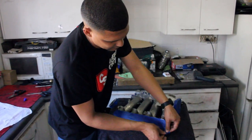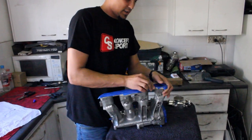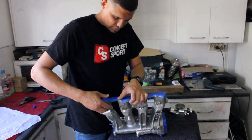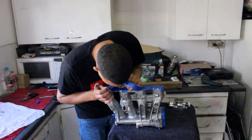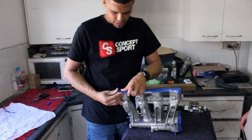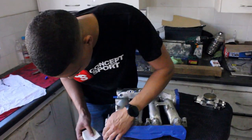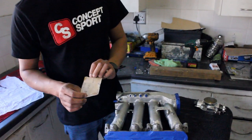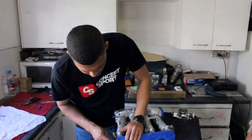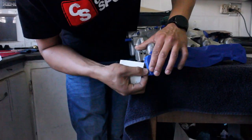First wrinkle. So what you do is make sure all the lines are showing. Just press it down so all the lines can show. Okay, just need a little bit more tape on this side. Let's see, small piece there, do it like such. Now what you use is a little bit of sandpaper. What grit is that? Look, this is like a 60 grit. It's auto body, this is where you sandpaper body filler. Production paper. So what you do is you just do it like such, sandpaper the edges, and it comes off.